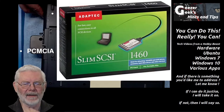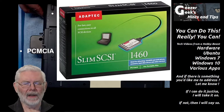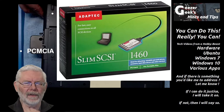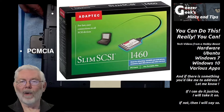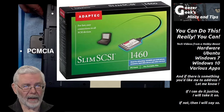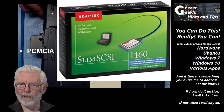This laptop offered expansion options through the PCMCIA slots on the side. You could get cards that provided additional functionality, slot them in, install your drivers, and you're good to go. I used one expansion card to provide a SCSI port so I could scan photos with an HP photo scanner. If this laptop could be used disconnected from any network or internet-attached devices, or had a currently supported operating system, it could still be useful today — I'll get into that in a later video.